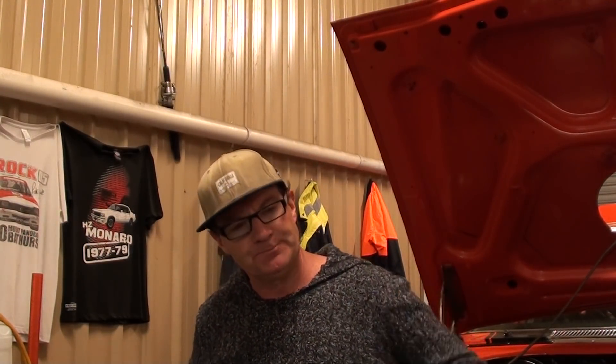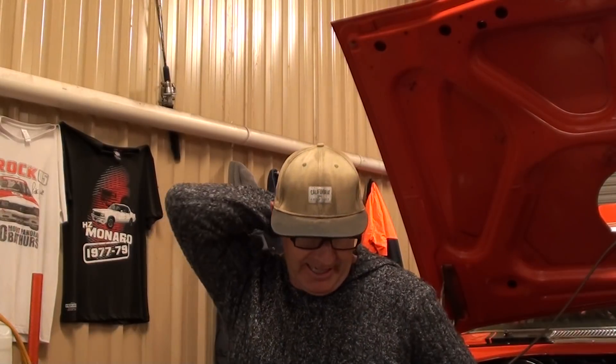There's a couple of little tricks that I know of through race racing, and I'm actually going to do another couple of little tricks that I've seen done on other motors. There's no reason why I can't apply this to this block to improve things. They don't have a mains priority oiling system - it goes through the camshaft first and then through to the mains. And these are known for spinning the bearings on conrods from oil starvation. It's not so much up to five, five and a half thousand RPM they seem pretty safe, but over that when you're pushing the envelope, getting up around six, seven thousand plus, you've really got to have the oiling system well sorted for longevity.